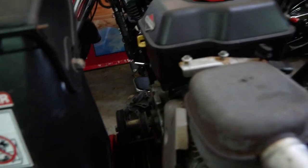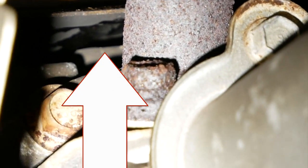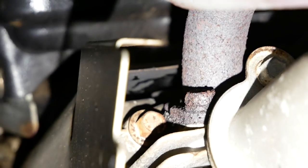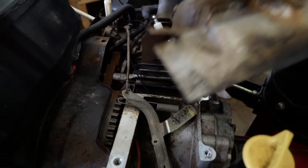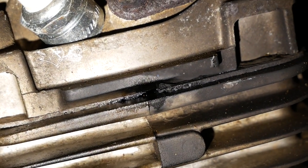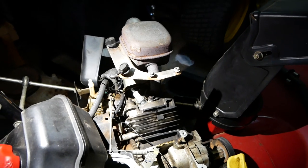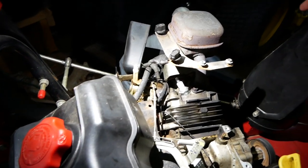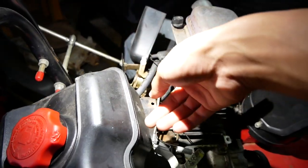This might be a little more in-depth than I thought — may not just be an exhaust gasket. Checking down under here, I don't know if you can see that oil spot that goes past where the exhaust is. It might actually be a head gasket. I just got everything out of the way, got this cover out. Suspicion confirmed — that is a blown head gasket right there. Now that we know, it's time to start disassembling. Fuel tank's already drained, so we'll just pull the line, pull the carburetor, the exhaust. Let's get to it.